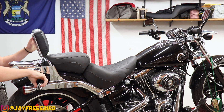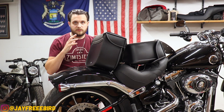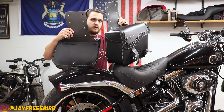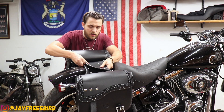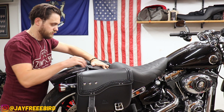Let's get them on the bike. Start tearing it down. Since these bags are universal, we're going to have to do a little customization — very simple as per directions to do it. What we need to do is lace these holes over these holes at the right distance we want, and just tie them together. Now, laying them over, you want to be well above the exhaust so it doesn't catch. If you get it close to the exhaust, they will catch on fire — that's definitely a fact, seen it before, very scary time — but this exhaust on this bike has a shield on top of it, so we're double protected, and I would say right about there.